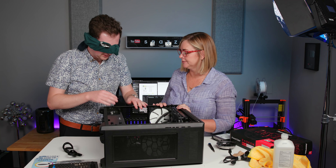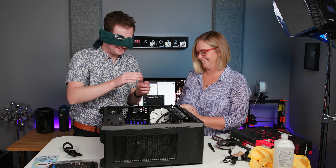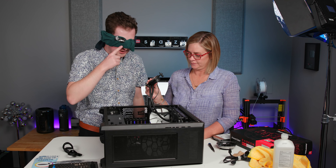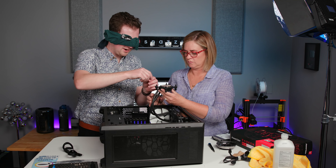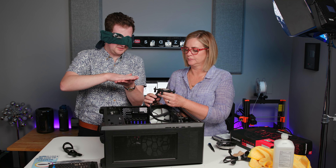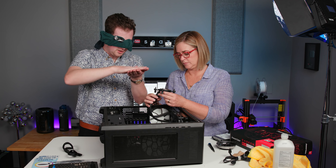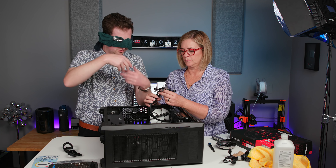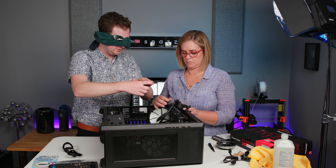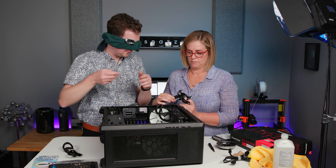I got the fan in. Now you've got the CPU block — the little dongle. You're going to need to plug that into the bracket, but first we have to apply some thermal paste. Thermal paste fills in the tiny imperfections on both the top of the CPU and the copper heat block, promoting thermal conductivity. You pull heat from the CPU away with the block, it goes through the tubes cooled by water, up to the radiator which cools it down, then it goes back into the cycle.